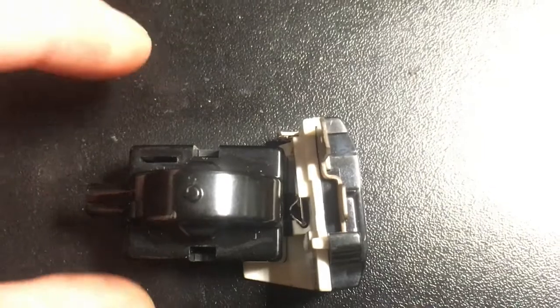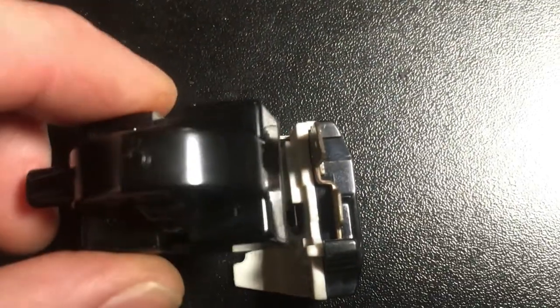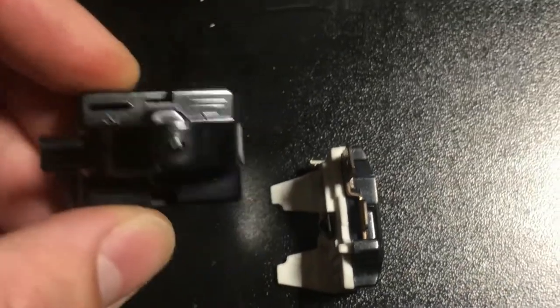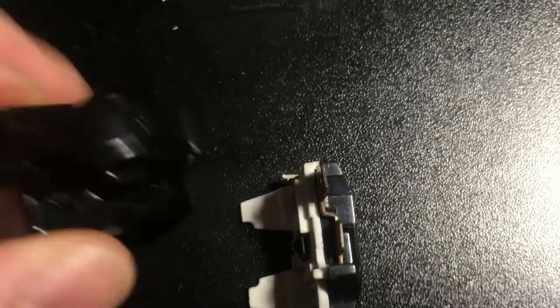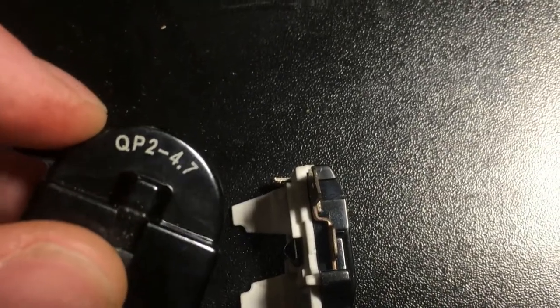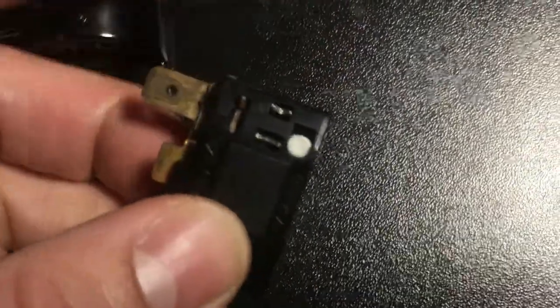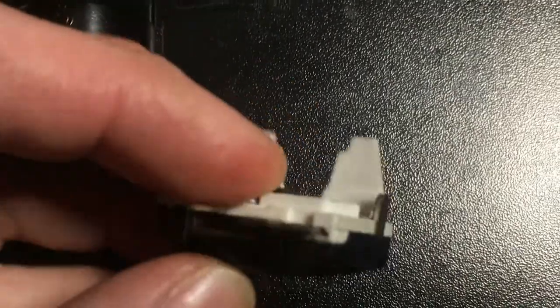It's on the side of the compressor and it pops off first — it'll be like this and then you pull it off. If you shake the one with the little sphere and it has writing like 'QP2-4.7' — the link will be in the description — if this one makes noise and rattles, it's bad.